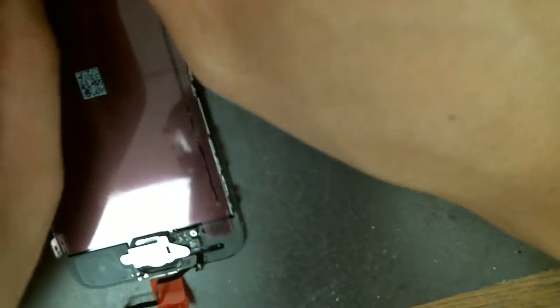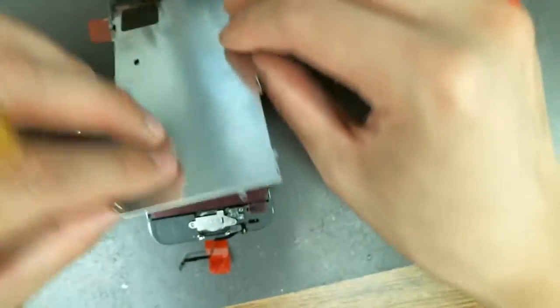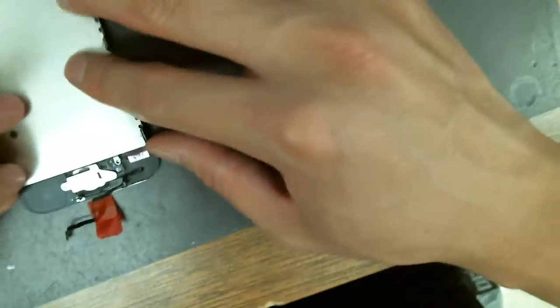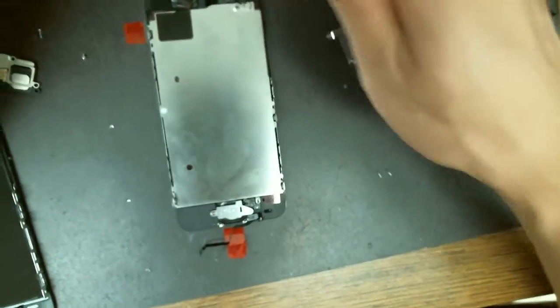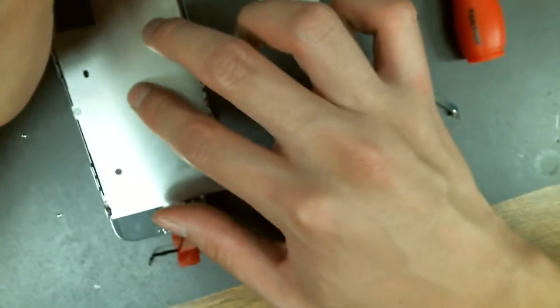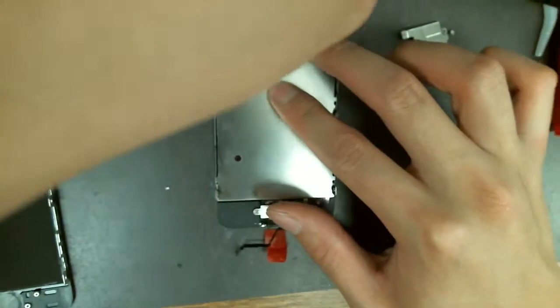For this iPhone 5s I might need super glue — or some kind of silicone-based glue would do it. Camera went in. Put the microphones first into the rubber boot and make sure the contact is done, otherwise it won't work. Then you can replace the whole face shield back onto the phone. I can see the merit in people buying these parts and doing it themselves — you really don't need to send it out. With these simple tools, plus or minus the magnetic mat, you just need a tweezer and a screwdriver. You can do this at home.